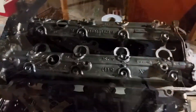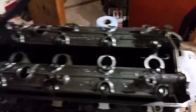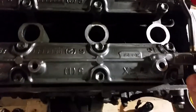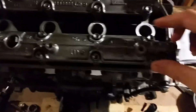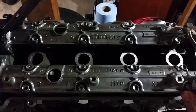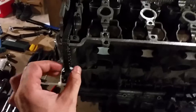I've just started taking some of it apart — the cam chain tensioner is out, cam chain is loosened off, the guide is out, the oil tube is out. I want to point out these numbers that are cast into the cam holders — they're there for a reason. You're gonna want to follow those numbers when tightening and loosening, because if you loosen all of these bolts and work your way down incorrectly, it can put a lot of strain on the piece and actually crack it. It's very strong but very brittle if force is applied the wrong way.